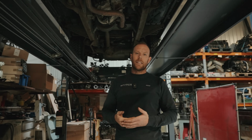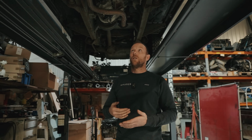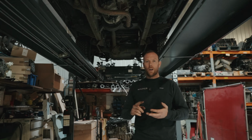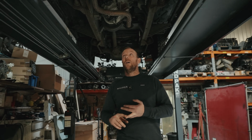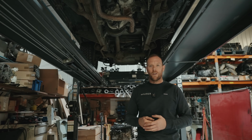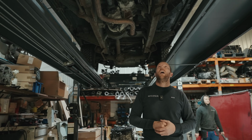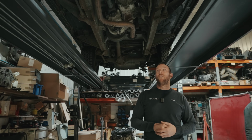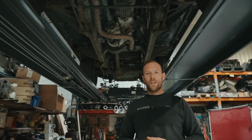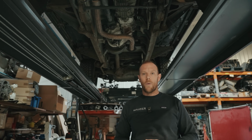And I said, while you're at it, Neil, let's improve the brakes. Let's improve the suspension. So we're going to go with polybush. We're going to go with heavy-duty arm kit. We're going to go with heavy-duty anti-roll bar kit. We're going to probably put some better springs and some better shocks on this car. I think he's going to go for the Bilstein 2.65s, the real big daddy shocks that you know I love. And he's going to go the full hog, basically. And while it's on the ramp and the axles are off, Bruno's going to work his magic and make the chassis look new again.